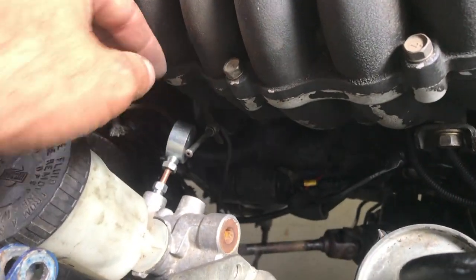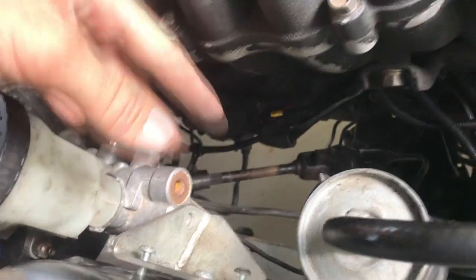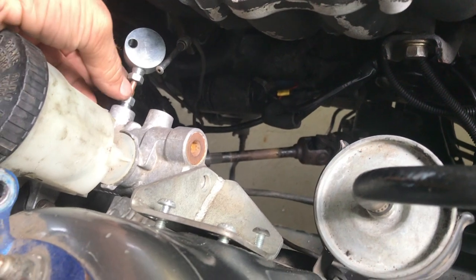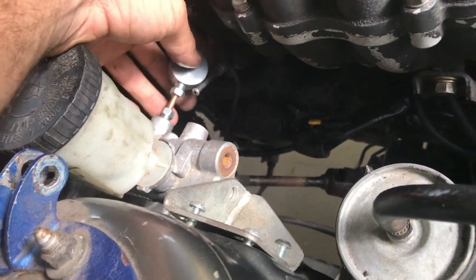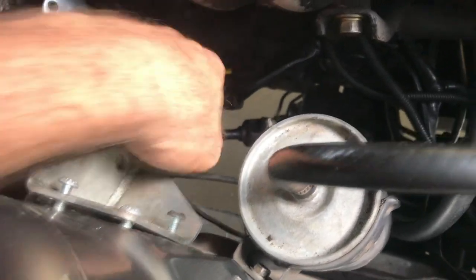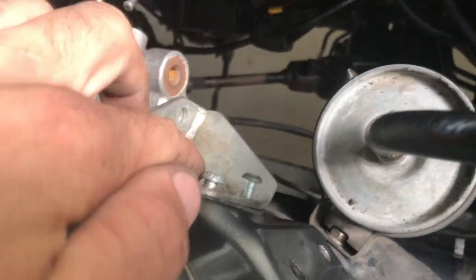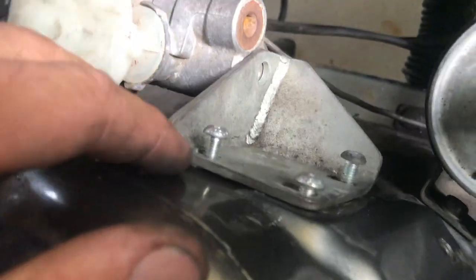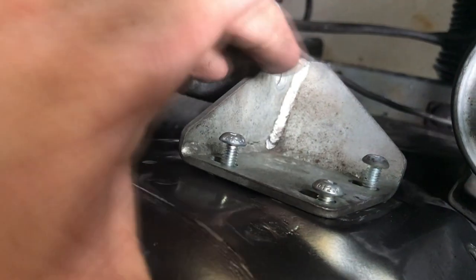The brake lines are going to be a bit more of a stretch. Luke adjusted them to suit when it was tilted over at 90 degrees, so I might have to get them to Bailey's Brake and Clutch to remake a 90 so these lines reach a bit nicer. I also need to reflare one of them to a double flare instead of a single flare - that's the rears going in here and the fronts go in there. Now this is the BMC stopper - the new style one that Arby Factory made - and if you have it all the way at the front of the slides it touches, so that will probably work.